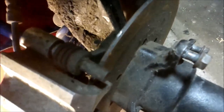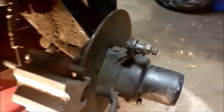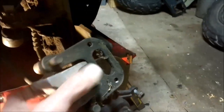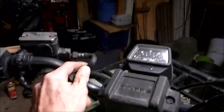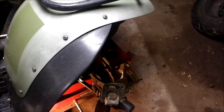Once again, remember what I said about buying somebody else's project - you gotta get a kick out of this - there are no brakes. I don't know why the guy took them off. So I'm going to spray these cylinders and clean this all up so I can push the piston in. The master cylinder has no fluid in it, and this is a goofy setup, so I'll probably have to bleed the master cylinder first, then go through the whole brake system to make sure all the old fluid is out.